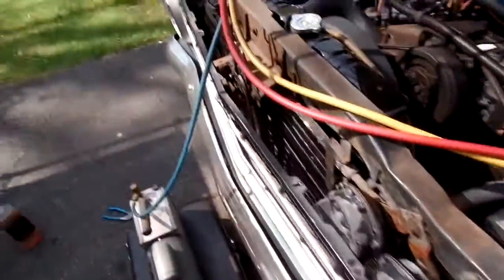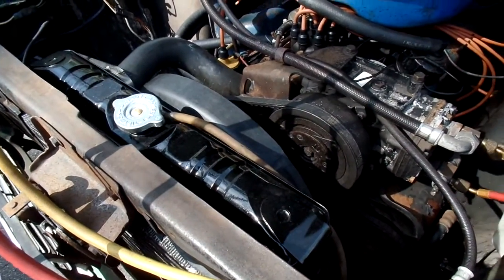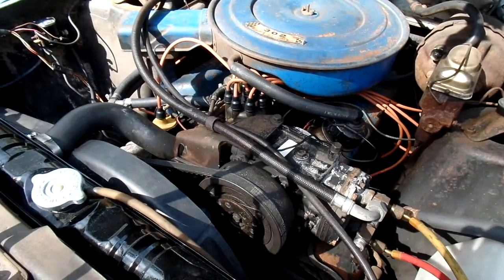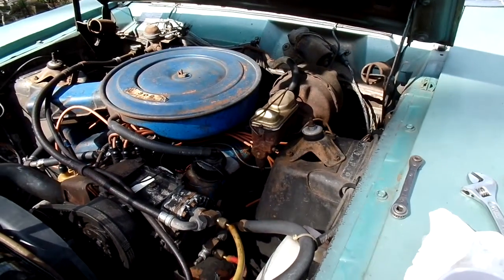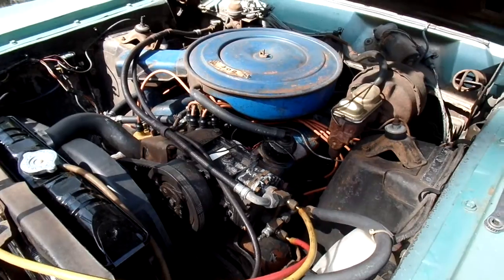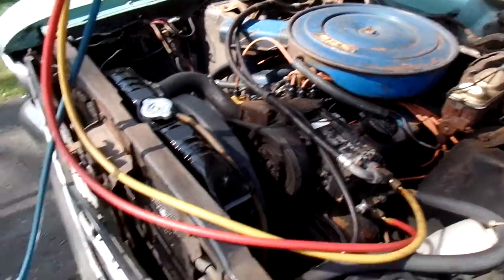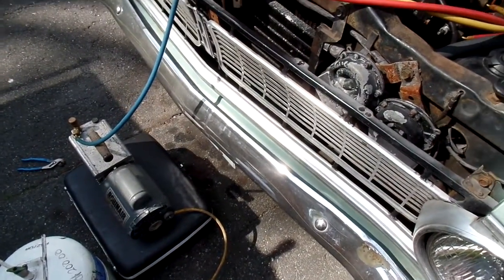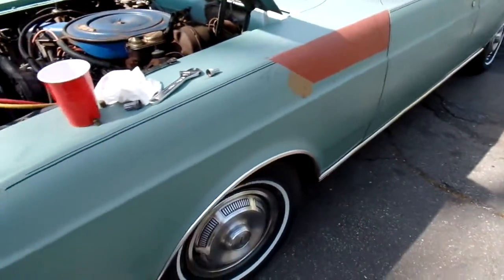And I think we got her dependable. We've got a new radiator. The brakes seem to be fine. It's very rare I don't have to do any brake work. I didn't do any brake work, except the adjuster on one side rear. The adjusting cable snapped, and the little adjusting bracket there slid down and was rattling around in there. Timing chain's good, new tires. So I think we're good.